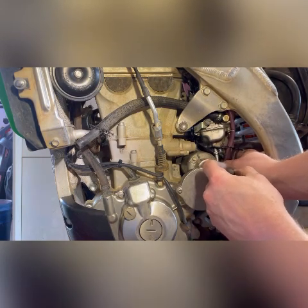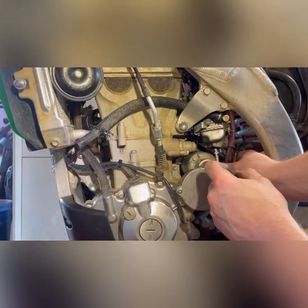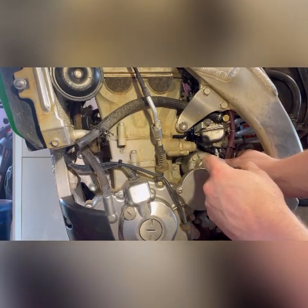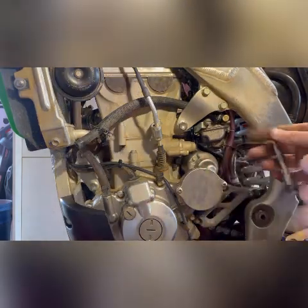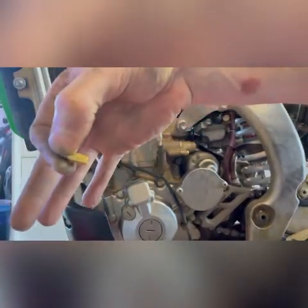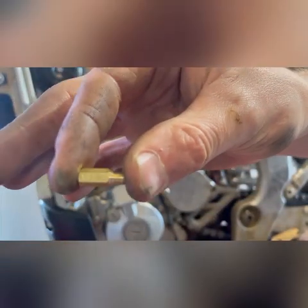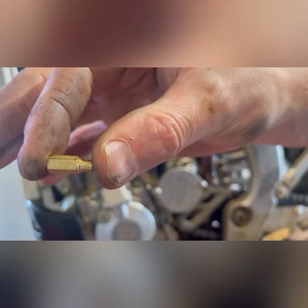And because we've got the full high dollar exhaust on it, we're gonna go wide open, the 170 main jet. Customer's gonna be hauling. Let's see what they had in there before. 145. It's gonna be so hard for you guys to see that. There you go, 145, which we will be replacing with the race mode 170. Bang.